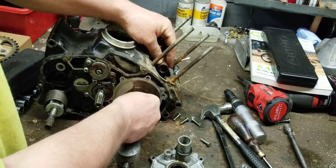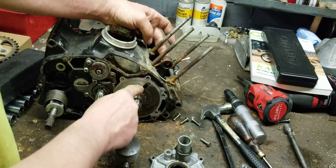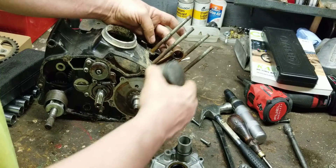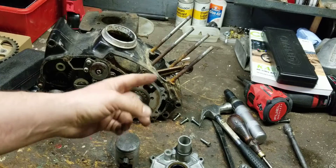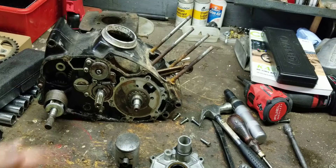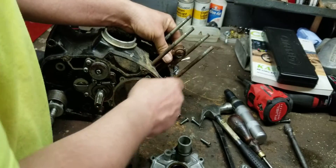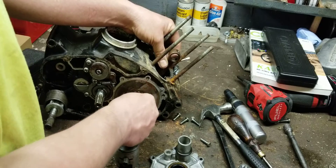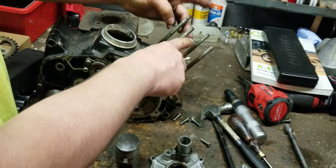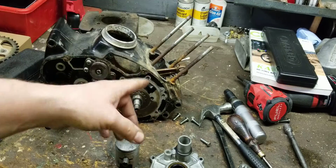Fuel is entering on top of the piston as the exhaust is going out — that's your power stroke. Now look — it's made a full revolution and it's coming back up. The intake valve opens again, sucking in fuel and air. It pushes that fuel and air mixture up on top of the piston. So it's sucking in fuel and air at the bottom, exploding on top, pushing down, compressing up through the transfer ports, and the exhaust is coming out.